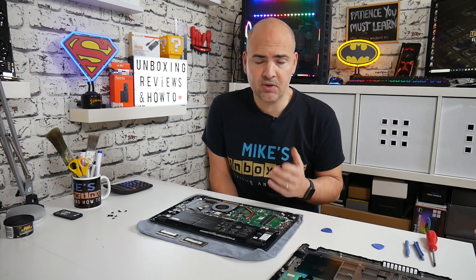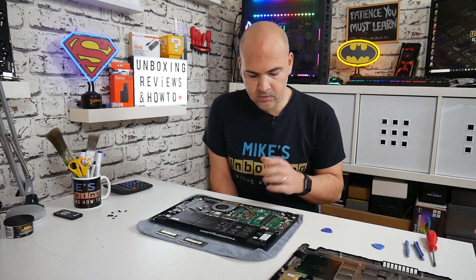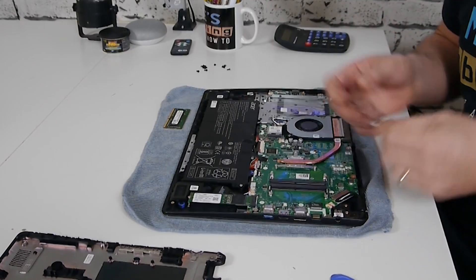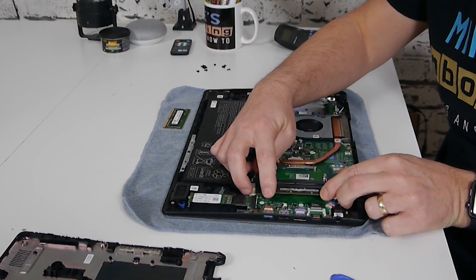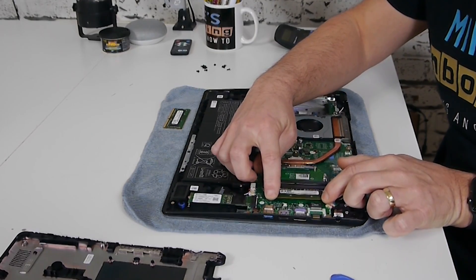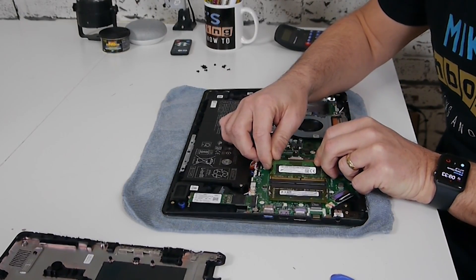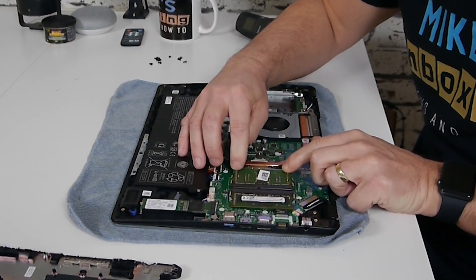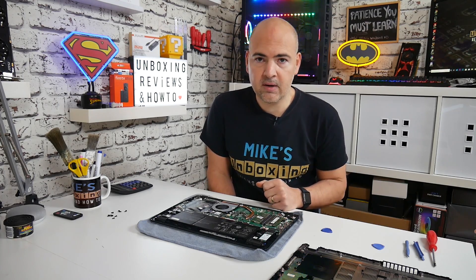Now this is one thing I was a little bit concerned about when I looked at the specs — I spoke to people and they confirmed yes, it is upgradable to 16 gigs. In most cases the RAM is replaceable but not necessarily upgradable, so do bear that in mind. Once you've got your RAM sticks out, all you need to do is reverse the process: with your new RAM sticks, put them in matching up the key on the RAM with the key on the retainer, gently push the RAM into the slot, and then with a little bit of force push them down and they'll click into place. Do that with both sticks, making sure you put them in the right way — just line up the key and a little bit of force and they'll pop into position. Then all you need to do is reassemble the unit, power it back on, and that's your RAM upgraded.